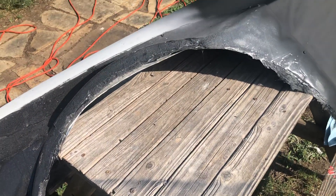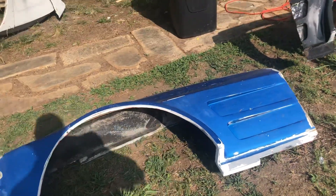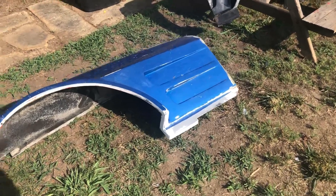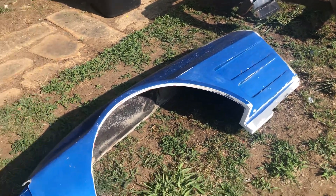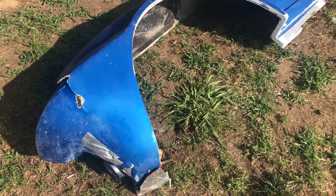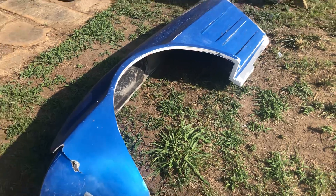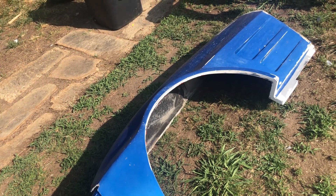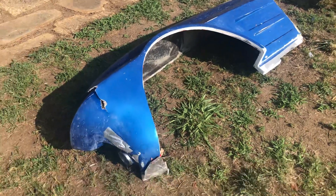Because the lip would have trapped the mold onto the part, I decided to do a mold that wouldn't be trapped, so I could get that nice inner fender lip. I quickly sanded it just to get rid of any major issues. This is a damaged fender — I didn't worry about it because that front part isn't part of what I need anyway. I put silver tape over all the damaged areas. I figured having a full mold even if it's not perfect was better than nothing. I sprayed it with mold release spray, mold release wax, and PVA on top, and needless to say it came out really easily.